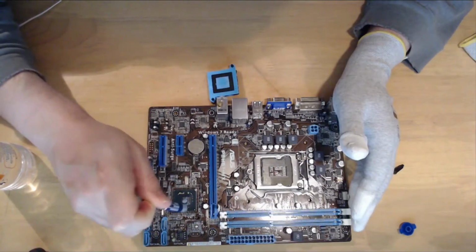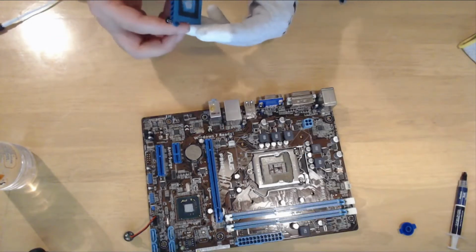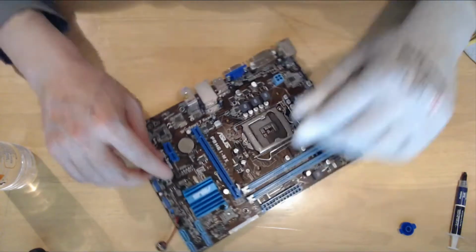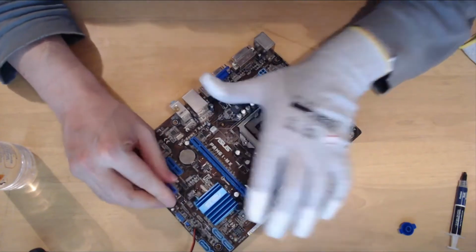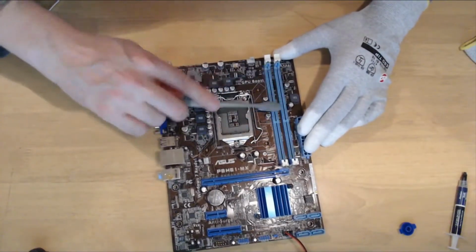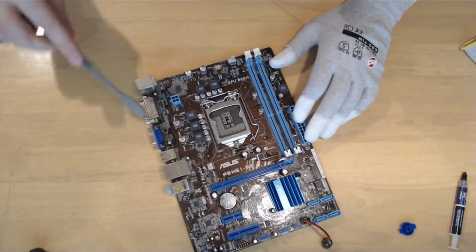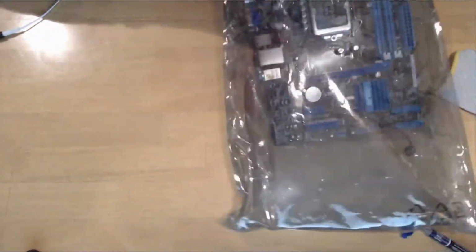Now it's time to apply thermal paste to the top of the chipset and put the heatsink back in its place by aligning the heatsink over the chipset so that the mounting holes are properly positioned, and press down until the two clips push through the board. Remove any trace of dust and any small bits of corrosion with a brush soaked with alcohol, gently brushing the motherboard's surface on both the front and back side. Store the motherboard inside the ESD bag to protect it from dust and undesired electrical discharges.